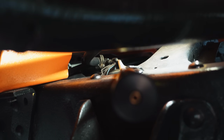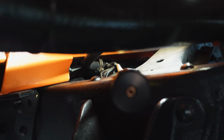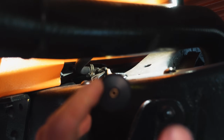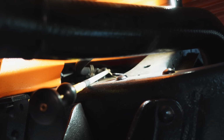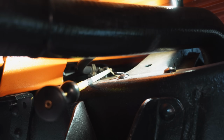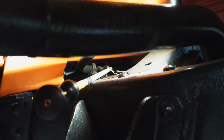The blue wire looks blue. That's 5 volts coming in, goes through the resistor that's in the float, and then comes out and gets grounded by the wire that I'm on, this white wire. It looks white. You know, the wire colors change, but if this ground is open, we're going to read 5 volts in this same location. Okay, loaded circuit, key is on, sending unit's powered up, and we're checking ground voltage.